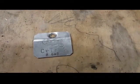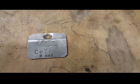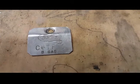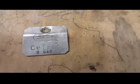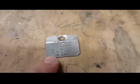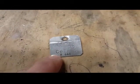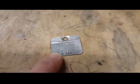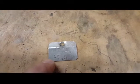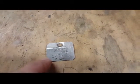Okay, so on this Ford carburetor, it had this little metal tag hanging off of a screw on the very front of the housing of the carb. So whenever you're going to start working on one of these things, it is very important that you know that this is accurate and that you get the parts and the rebuild kit for this tag. If there's any question at all that the tag may not be right or is missing, you might have a really hard time getting a rebuild kit that's got the right pieces that are the right sizes for you.